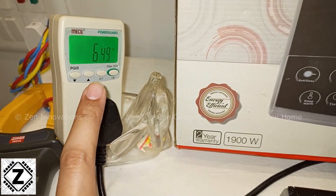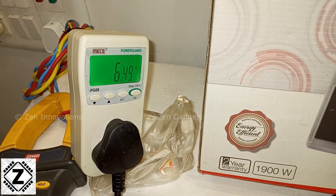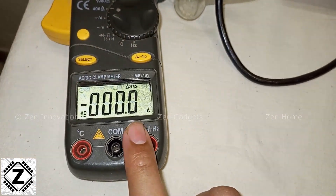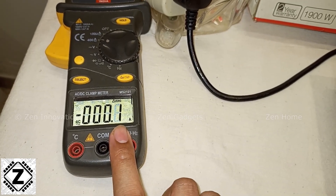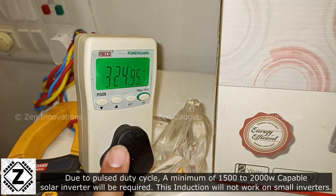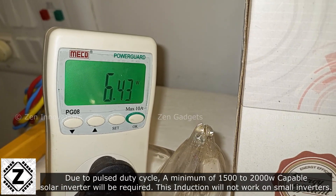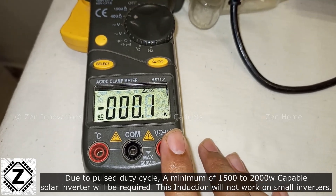When the coil is off, we can see that the power consumption of just the fan running is six or seven watts. With the coil energized, we can see the actual consumption on the meter — somewhere around 1000 or 1100 watts. This watt meter is a little slow to react, but you can find better reaction on this clamp meter. Let's wait for the coil to energize — and there it is: 3.3 amps, and I saw it going from 3.3 to 3.6 amps. The wattage I saw was actually 1000 or 1100 watts on the watt meter, though there's a bit of lag. The clamp meter clearly shows 3.3 amps when the coil is activated.